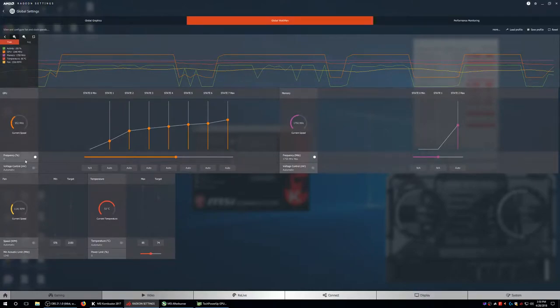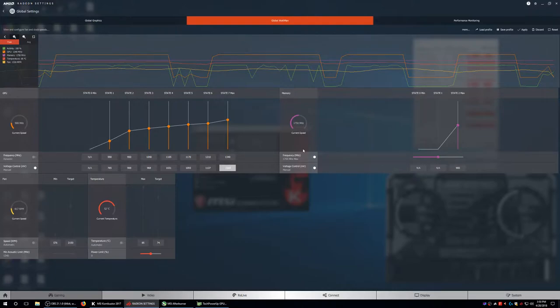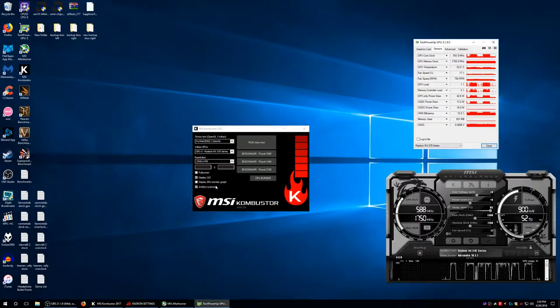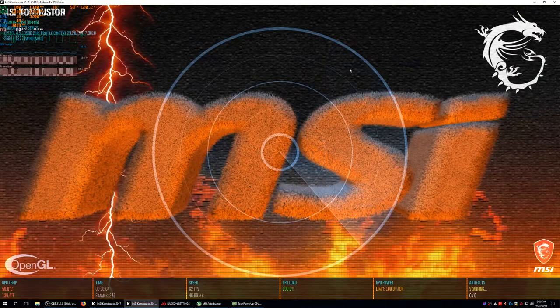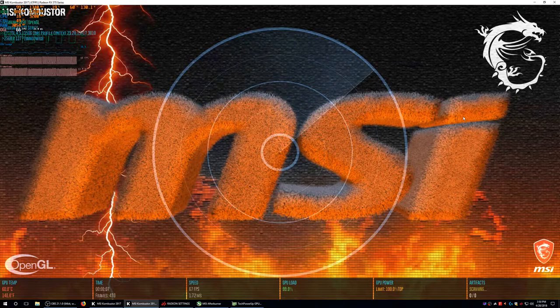Let me reset this and put it back at 980 mV. So instead of touching those other states — that may have screwed it up. I know if I underclock it to 1244 MHz, I should be able to get down to 900 mV. Because I didn't use this program before — I did it all by eye in Heaven and other benchmarks.